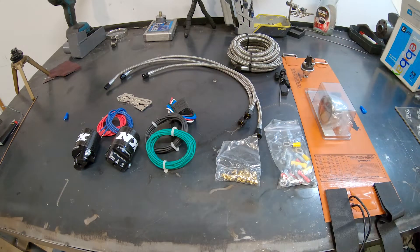The bottle is going to sort of sit like this in the car. According to the instructions, it says put the second bracket seven inches above this bracket, which I think is a printing error for this bottle size. So I'm going to make a frame that goes from here to here, come down one side. I also have to kick it on a bit of an angle to make sure the pressure gauge assembly I've made clears where it has to go - this side has the gauge and that's the sensor for the blanket. So we'll make a little frame that'll bolt to the car with some studs. I started making the frame for the nitrous bottle out of steel, which would be like this shape bolting into the boot, as you will see in this quick little montage.